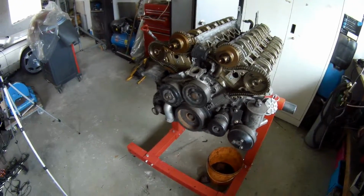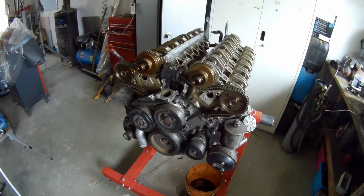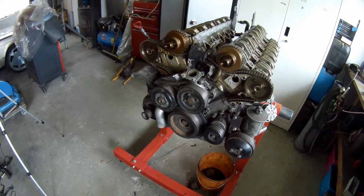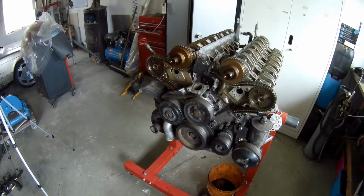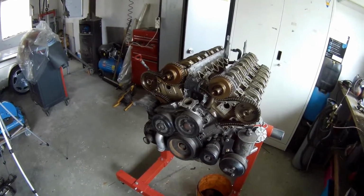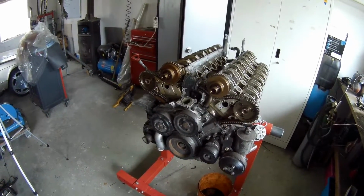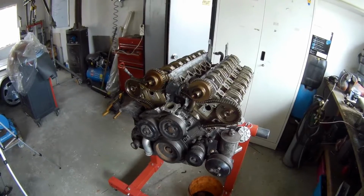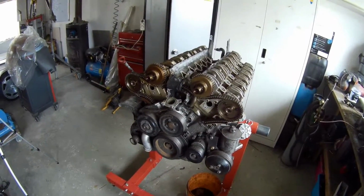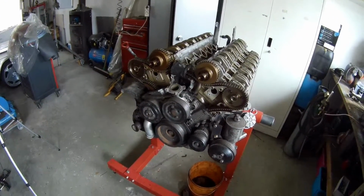I talked to some guys I know who are very familiar with Mercedes, and the guy said to me 2 degrees is nothing. That's like perfect. He normally recommends changing the chain when it's about 12 to 13 degrees of stretch, when those engines are still running. I think that's pretty special if you have 13 degrees on a diesel or something. It runs a little bit rough, but it still runs. So he says 2 degrees is nothing.